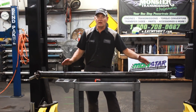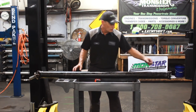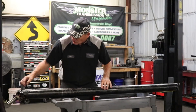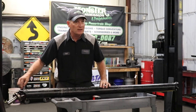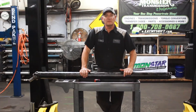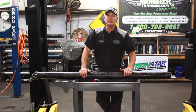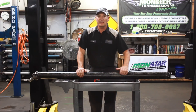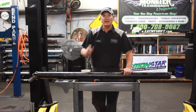That's the basic measurement of the driveshaft. It will be center of this section of the U-joint to the front center — that will give you the overall length of your current driveshaft. If you have any other questions, feel free to give us a call at 1-800-708-0087 and we'll have one of our techs talk to you about any products you have an interest in. Thanks and have a great day.